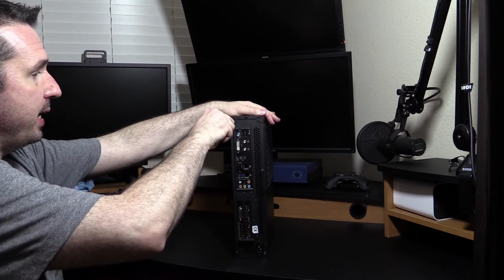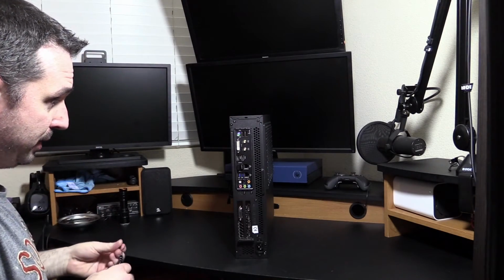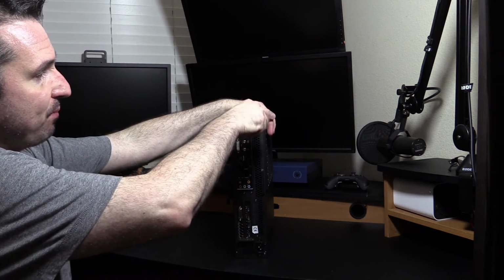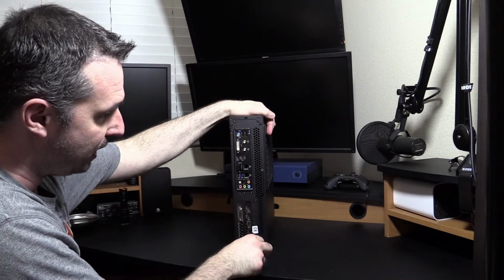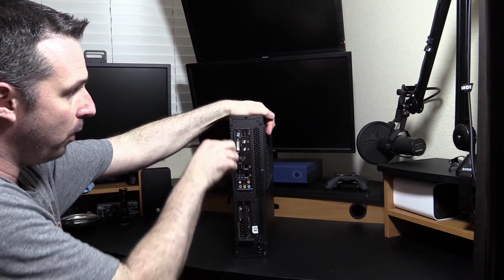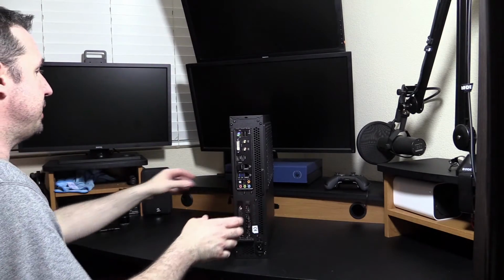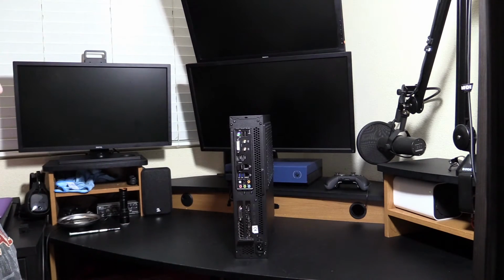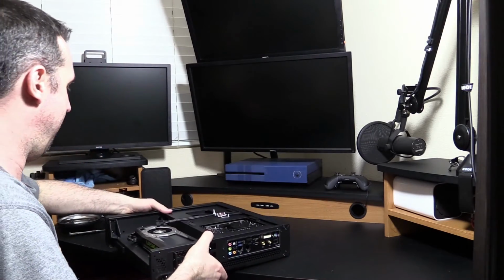It's a 600 watt, and I did that for two reasons. One, I want to be able to put any GPU in here that I want to. And two, because it's 600 watts, let's say I'm running this 1060 in here, it's feasible that fan won't have to be on very much, all right? Because the 1060 has one 6-pin connector. It doesn't have a high TDP for the most part. Of course, I'm putting it in an oven. But still,